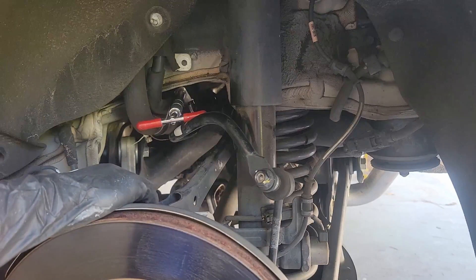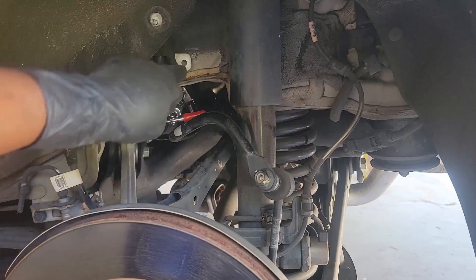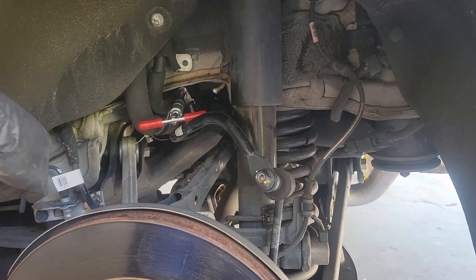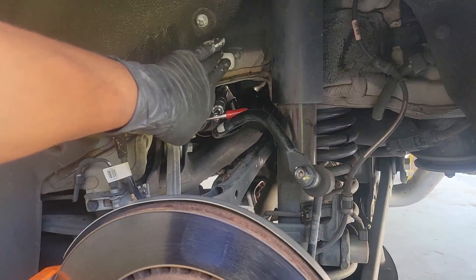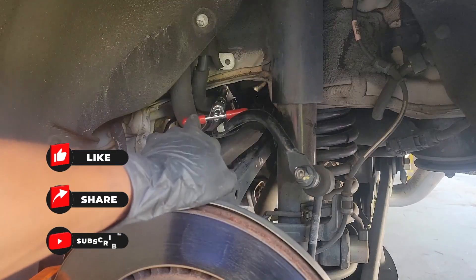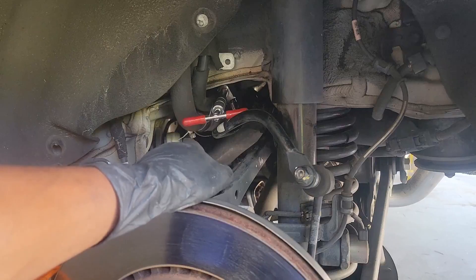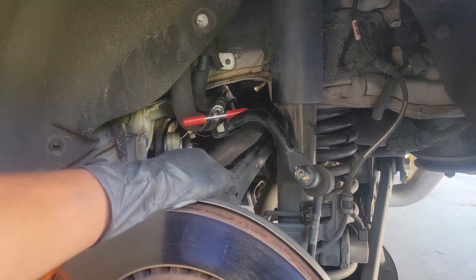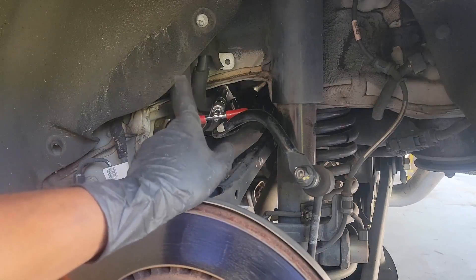After trying a few different combinations to get to that inside nut, I couldn't get there. So what I did was go ahead and take the plastic nuts out right down there, just out of view, and took this tin panel off — it's kind of hard to pull off that bracket and push to the side since another one bolts up there. It's pretty stiff, but if you just push on it a little bit it'll flex over and give you slightly more room to fit a socket head and your ratchet to get the bolt out.